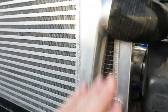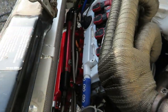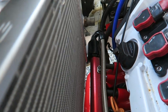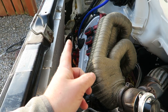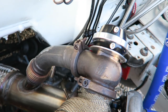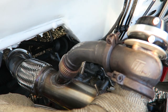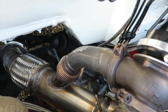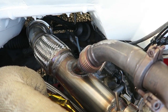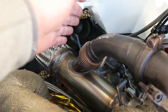Because I've had to put a big intercooler on the front, it's also pushed the rad back into the engine bay. My measuring was bang on — not much room there. It's a solid mount so it's not going to move around much anyway. I know a few of you might be disappointed to see that I've routed the wastegate back into the exhaust pipe, but this is going to be used heavily on track and because of that I just wanted to make sure I route this back into here.